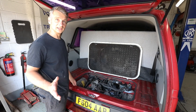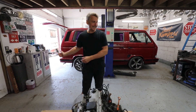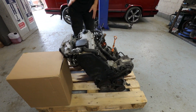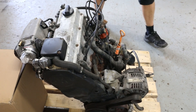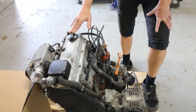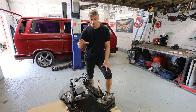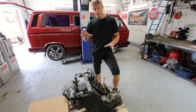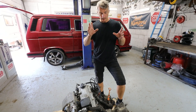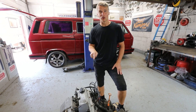So our solution is a Golf GTI engine. We're going to remove that old diesel, get it out, and we're going to be putting in our two litre Golf GTI engine. This is from a 1997 Mark III Golf, 86,000 miles on the clock — we know that because we've got the history, so we know it's a good engine. This is our donor. We're going to be swapping parts over because we'll need the oil pickup and various parts from our diesel engine. But very exciting — 113 horsepower.